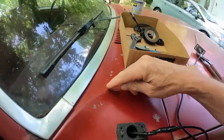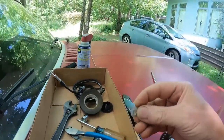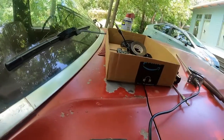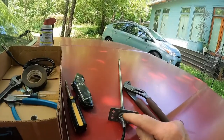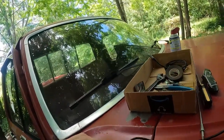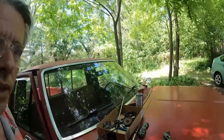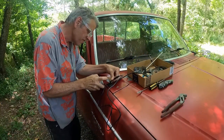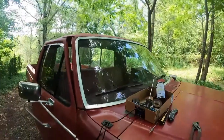We got this ready to feed through. There is a little grommet underneath there in the firewall, and this is ready. You broke these tabs off because you're not going to use those — you're not using a round hole. You need the original Ford square thing back on there, so that's why you re-drill that. We sprayed a little WD-40 on there and we're going to go in and pull this right now. I've already took the glove box out, the insert, and unhooked it from the radio.